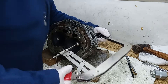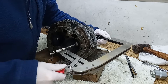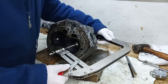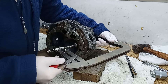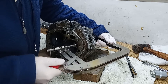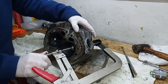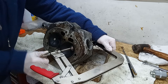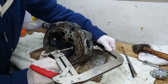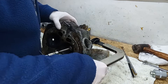It needs to be done up a bit. Then clamp it up — if it's too tight it won't clamp. There we go, make sure it's on as central as you can around the valve, and then wind it up. So what we're doing is we're compressing the spring at the top. That's about as far as my compressor will go.